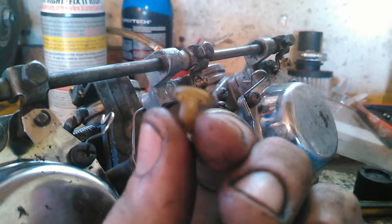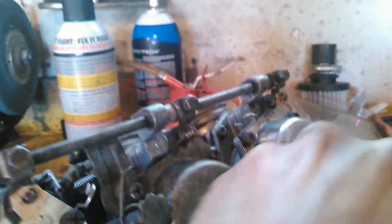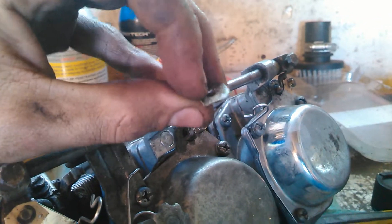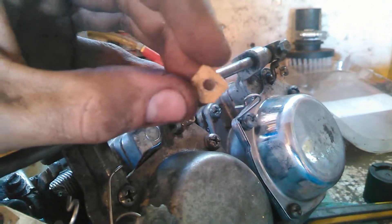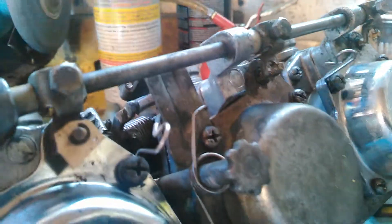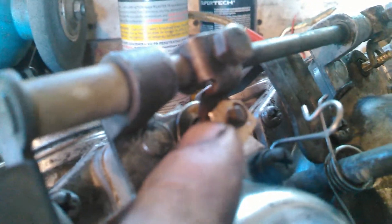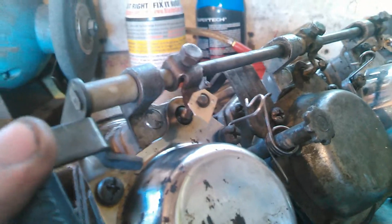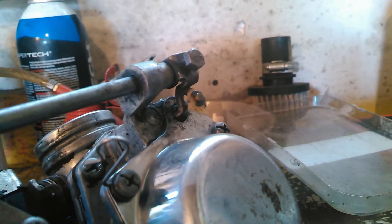What I've done is actually cut out little pieces of tin and drilled a hole in them the right diameter for the choke arm to fit through, then put an E-clip over it so when I lift it up it actually does engage the choke again. Here's an extra one I made.